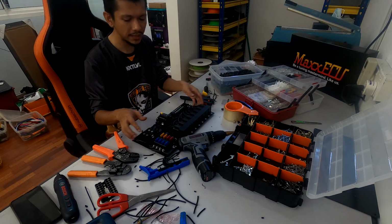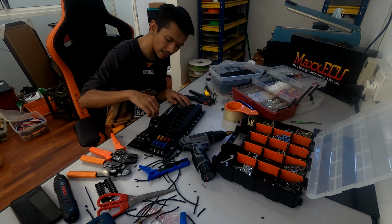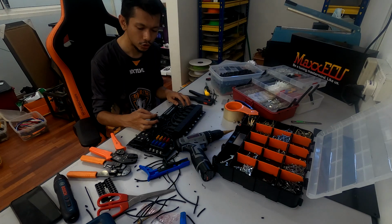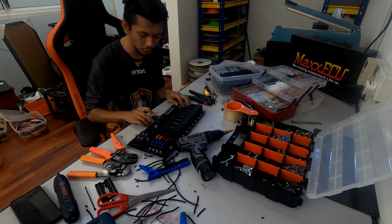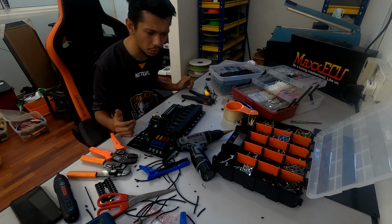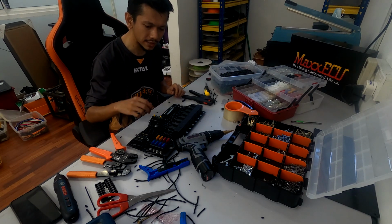So I'm going to make, as you guys know, the board on the trunk close up on this panel, right? So right where the board is going to close here, I'm going to make probably a 14mm hole right here, all right? That way if anything happens, I can just pop the trunk and press the button. And there you go, the breaker switch is there. I don't want, if I have items or groceries and anything goes wrong, to have to move the groceries, pull up the trunk board and hook it up and then press the button. I want a hole and direct access.